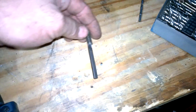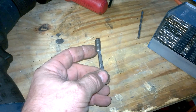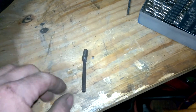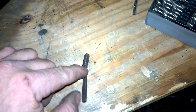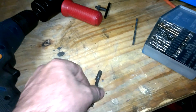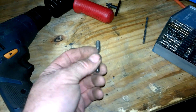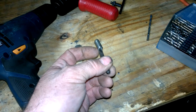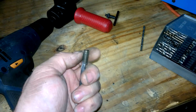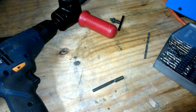This is what the extractor looks like — you can see the angle it went in. The drill bit walked a little bit and you can only get a certain angle, but as long as I went into the bolt through its mass, I'd be okay. The sharp edge is what bites, so turning it backwards, it had to work against the outer threads in the head. I had to beat it in with a hammer a couple times as I turned it to finally get a bite and knock it loose. Once it knocked loose, I grabbed my camera because it just turned easy from there. I'm so glad that worked out, and now I'm gonna have all the bolts in holding the manifold properly.